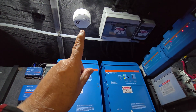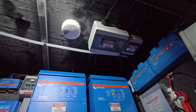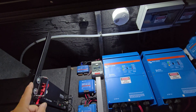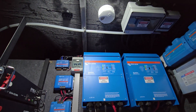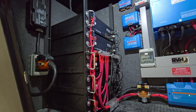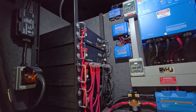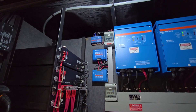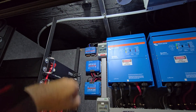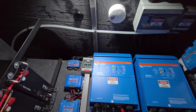You'll see a fire alarm up here. This is a network fire alarm — there's another component inside, and if this one rings, the inside one rings. This white tube is Proteng fire suppression. It will suppress a fire in this area. It will not stop a battery runaway lithium battery fire, but that's so unlikely to occur unless there's another fire in the area that lights it up. Our strategy is to put out anything that's in here as much as we can, and it swings up over the propane area through the main compartment, protecting components beyond what's just in here. We put that on every rig.